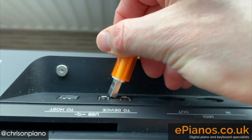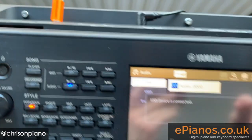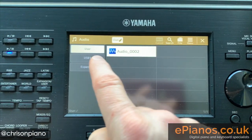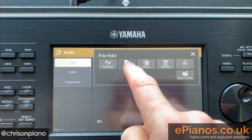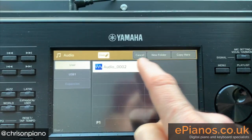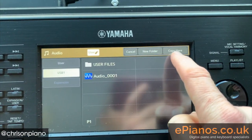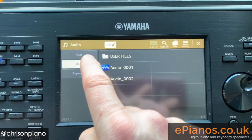If I put that USB back in the back — it's never the right way around first time, is it? So the USB has been connected and up pops USB one just there. To get it from user to USB, we press file and copy. If it's not already highlighted white, you just need to press it and it will highlight white. Press copy, then it says where do you want me to copy that to? We go to user and press copy here and it will paste itself just there. So that's now safely on the USB stick, as well as being on the hard drive of the keyboard. Thanks very much for watching, hope that was helpful to you.